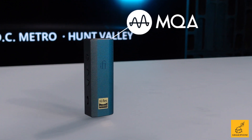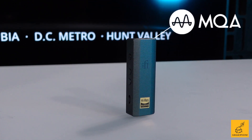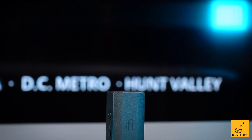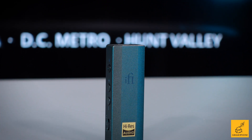Finally, this can do MQA, so if you've got Tidal on your phone, you're good to go. In terms of power output, this thing is pretty impressive. This is not an easy-to-drive headphone — it's 300 ohms, which is way up there when it comes to impedance — and with this device I nearly had to turn it up to max, but I could still be about one whole bar off the top volume setting and have them cranking pretty good.